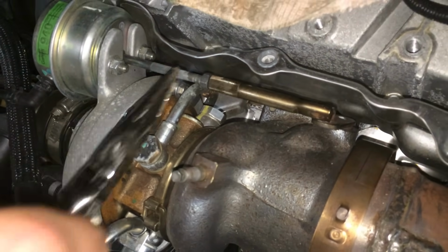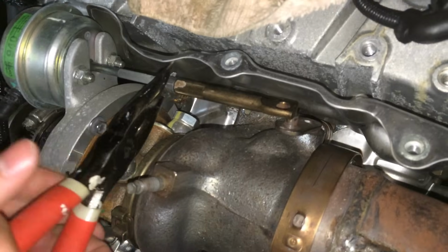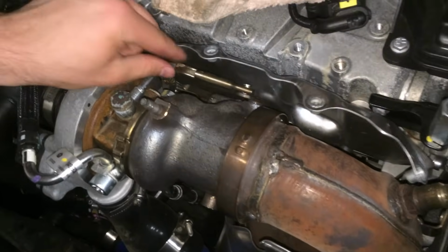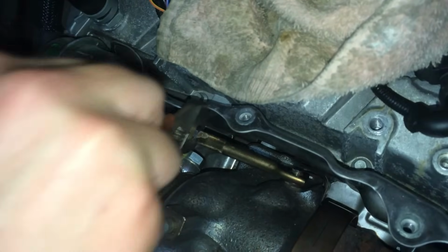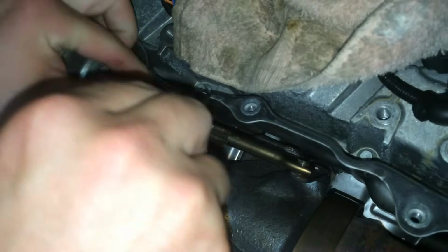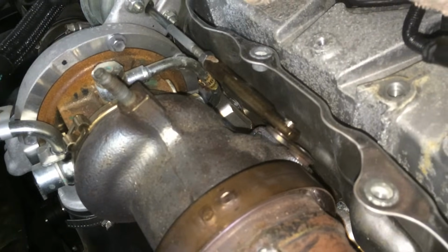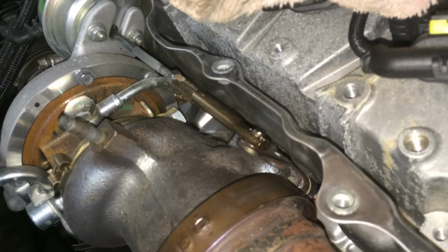And what you're going to do is take some pliers, line this up, and pull and get it on there. And then you simply get the nut back in position and tighten everything up. And then don't forget about your little C-clip. Be very, very, very careful when putting it on there not to drop it. And you'll hear it click, and now it's in position. And now you've adjusted your wastegate. So, thanks for watching.